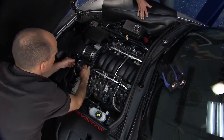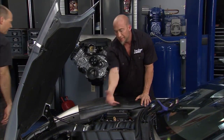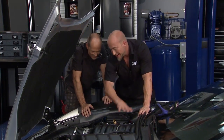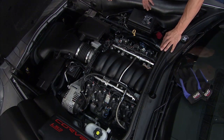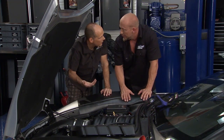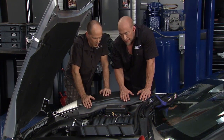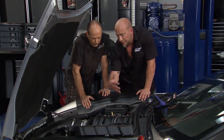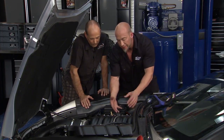We've got some T3s and T4s going in the back — thank goodness, because trying to do a front-mounted turbo system here would mean heat-shielding just about everything. Accessibility is a big issue up front; you can't even get to the plugs easily with this much stuff under the hood. Front-mount turbos also require custom exhaust and generate a lot of ambient heat, whereas the rear-mount keeps everything out of the way.